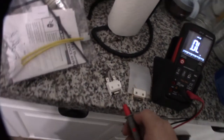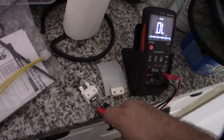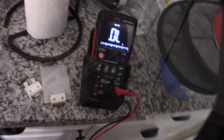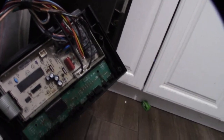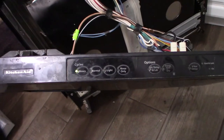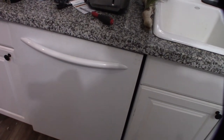The pump is free — it's spinning around in there. Now before putting it back together, I'm checking continuity on both fuses: the old fuse shows no continuity — bad fuse. The new fuse shows continuity — good fuse. I seat the new fuse back in, apply power before fully reassembling, and awesome — the power light comes on! Back in business. With a couple of tools and basic troubleshooting skills, you never have to call a repairman again.